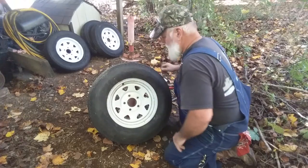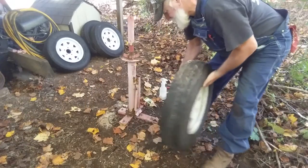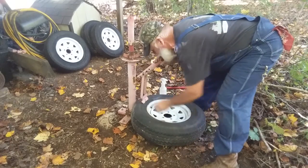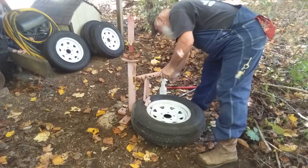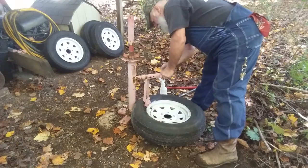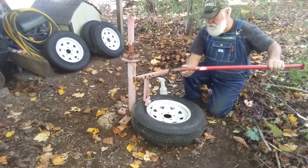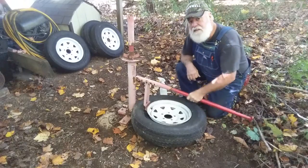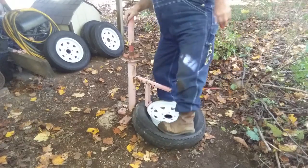Now we're going to be careful. I bought this here at Harbor Freight for about 70 bucks and I've changed a lot of tires on this thing. If you want to get it close, just close to here as you can and get it right along the edge of the rim. It won't hurt to spray a little bit of soap around there to kind of make it easier to break. Now they got this bar that comes with this — it's a tire tool and you also use it for leverage. That broke that bead and you kind of want to step around it and get it down good.